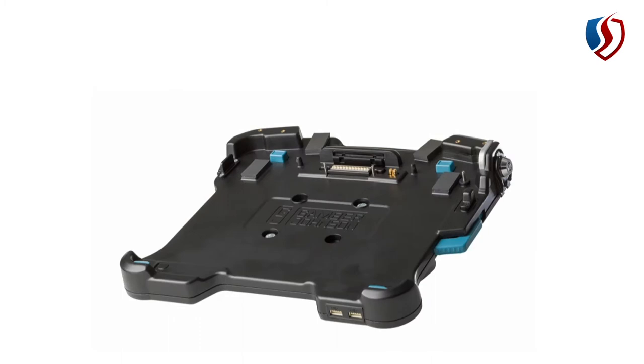This is a docking station. You can tell because it has a connector here — in this case the connector that goes to the Panasonic Toughbook CF-33. That connector mates with a connector on the bottom of the computer, passing power from the docking station through to the computer to charge the battery. It also passes port replication information from the computer to the docking station for things like printers and other devices.